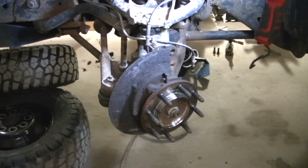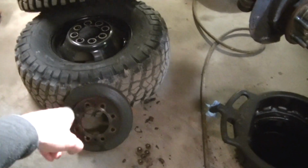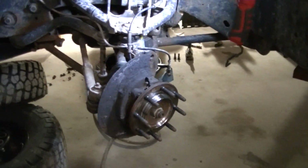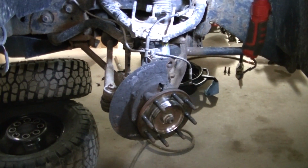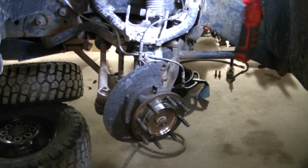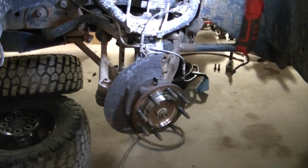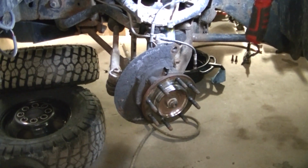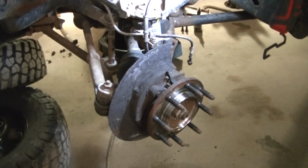That ABS sensor would kick off on me, and also you can see the brakes ain't even working very good up here because I'm not sure. I don't think it's the sensor. The guy, before I bought this, did a brake job and he didn't do the calipers. And when you're over 100,000 miles, and you do a brake job, you really got to do the calipers too, guys. They just get cruddy and they start sticking, and then you got cruddy brakes. So it's a whole lot easier just to swap the whole thing out. Pads, rotors, calipers.